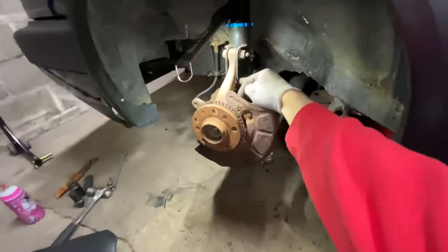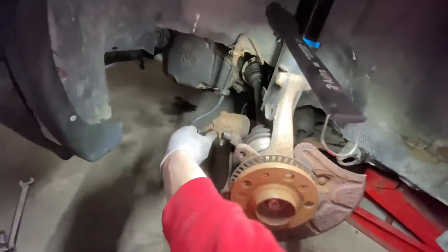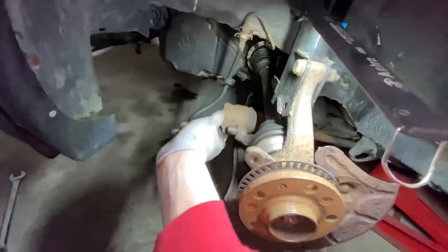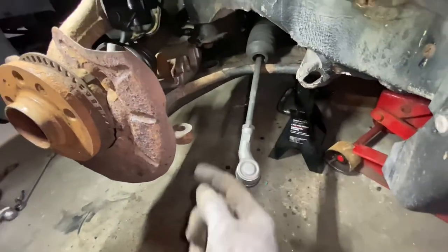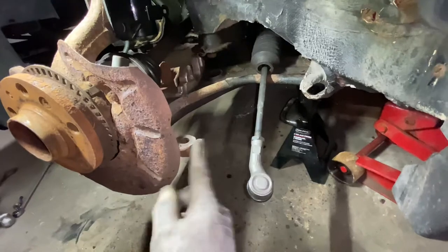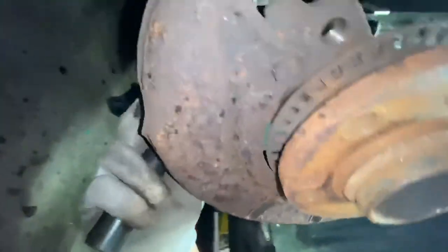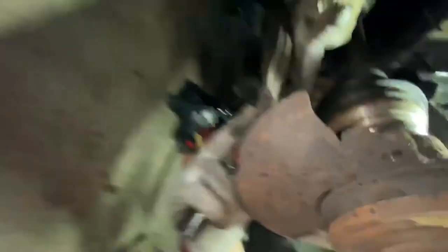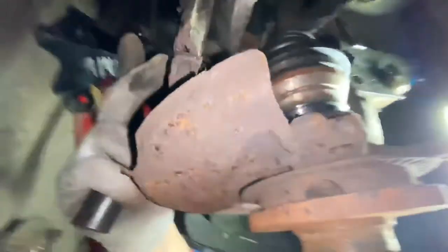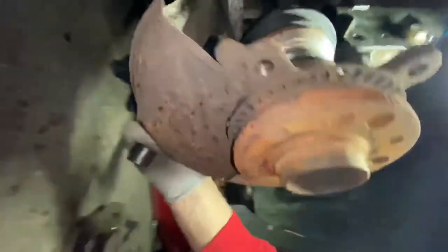So I got one of these out, this one here is going to come out shortly. Got the axle nut off. Brake caliper — just place it or hang it up somewhere so you don't want it being pulled down. Undo the bolt — my case was a 19. That sits in there. Whack this here a couple times and this will pop up a bit, then you're good to go. Now there are three bolts on the lower, underneath. One of them is broken — it's pretty common. So I'm going to take off the other two. If they break, they break; if they don't, they don't.